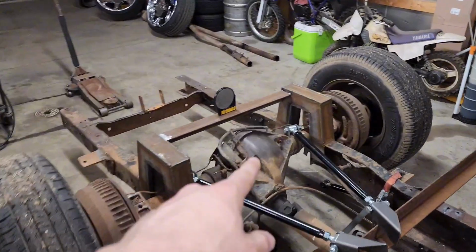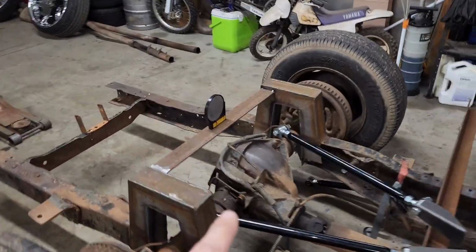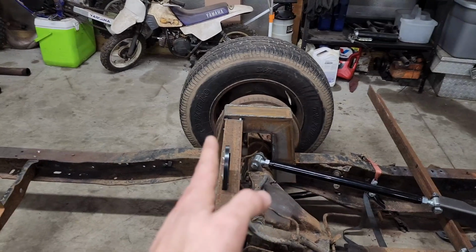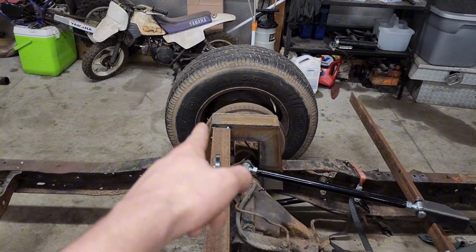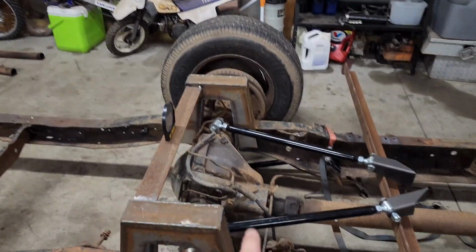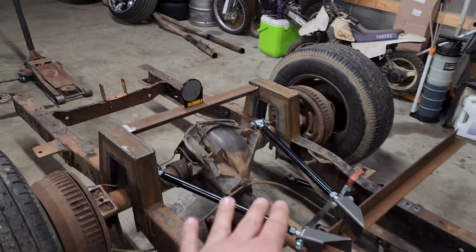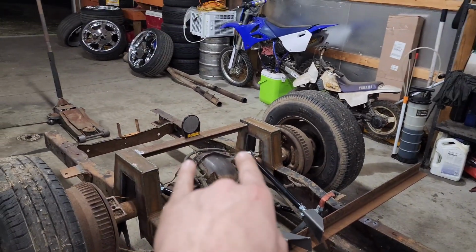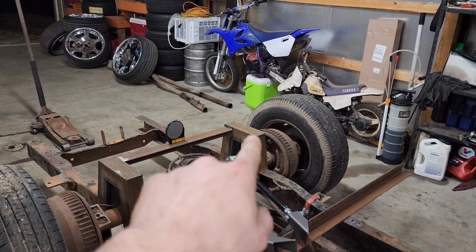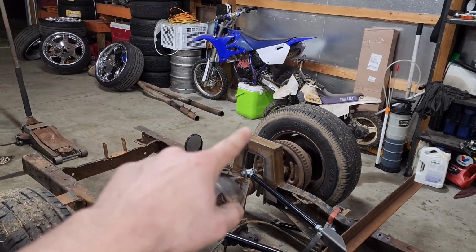Another thing I did was I put the jack under the differential and I jacked it up real high. And since it's a 1-ton rear end, I'm going to have to put my rear support a little farther out. Might put it on the corners instead of on the inside because it barely catches that differential cover on this lip. And secondly, whenever I had these mocked up on top of the differential, at full articulation, I put my heims there above the bottom surface of my notch here. And granted, the pumpkin might push up a little past that.